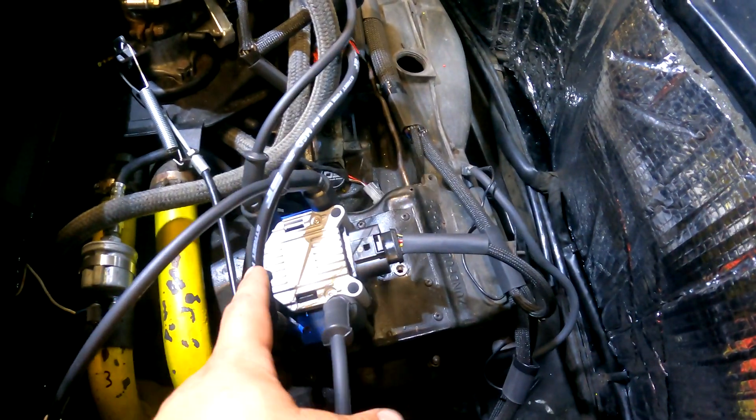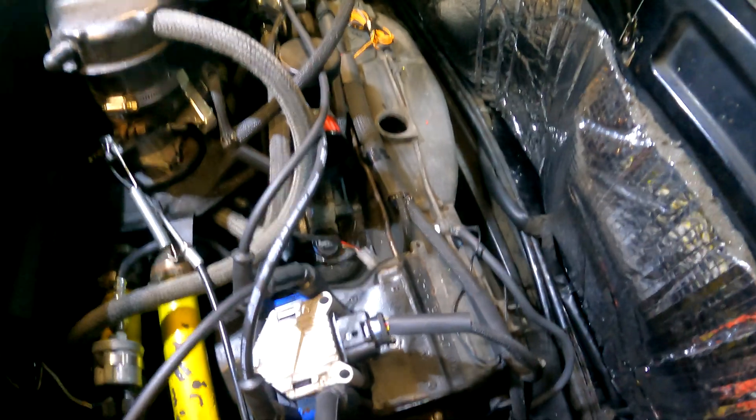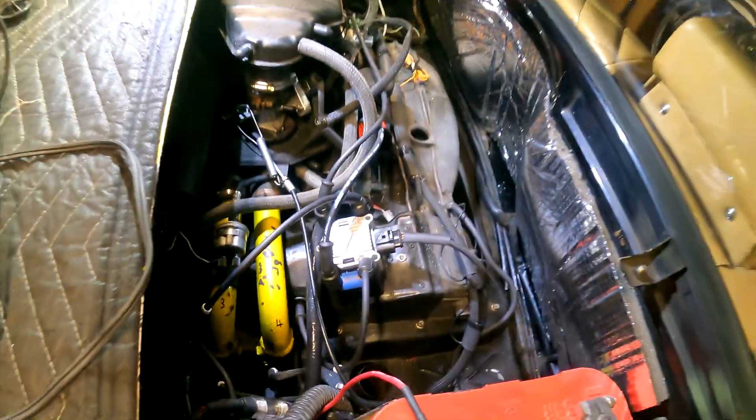I had to change the ends on the plug wires that are already made and re-terminate this connection. I don't have the disconnect tool so I just cut it and re-crimped it. But theoretically, that is everything we need. So we are going to go into the software, get on the tech support line, and have them coach me through the first startup - turn off the injector, check the spark, check the timing. Fingers crossed there's no issue with those ground outputs for the ignition. I really don't want to have to pull new wires from ignition outputs 3 and 4 because that sounds like a hassle.